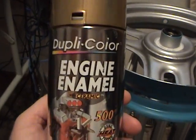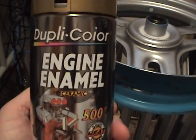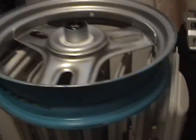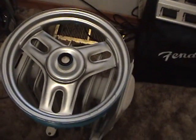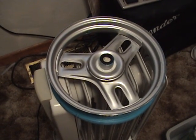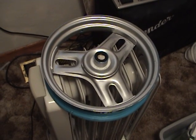It'll come out like butter — absolutely beautiful — because you just don't know how long these cans have been sitting or when they were made. It's good paint, but the better it's shaken and mixed up, the better it goes on. So that's where we're at with the replacing the bent gyro front wheel project. We'll let that wait overnight, nice and dry. I'll tack it off and give it two coats of gold, let it sit another day, then we'll do the clear.